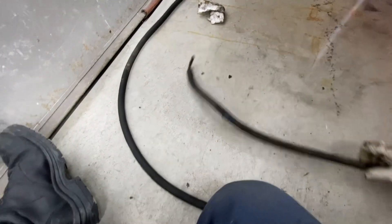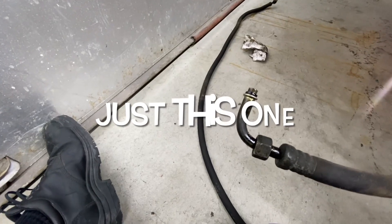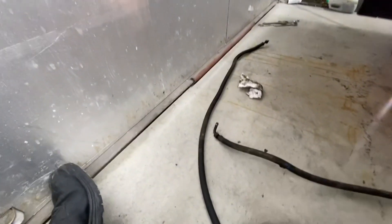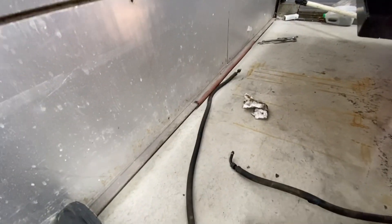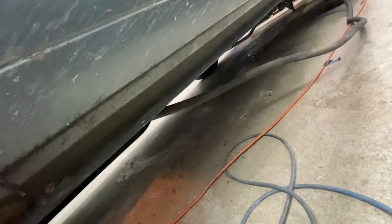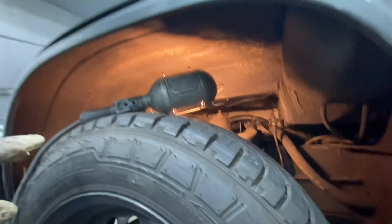Success! That's the way to do it — you've got to pull it out through the front. That's the connector for the condenser. The other end is straight and went to the dryer, so it's able to go through all those holes relatively easy. Now we've got to do the same thing with the larger hose, which has a straight fitting that came off the back of the compressor. We'll pull this whole mess forward a little bit at a time.